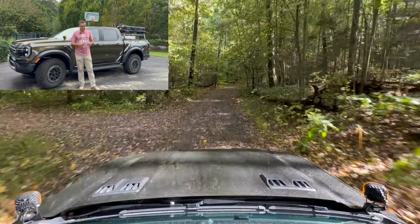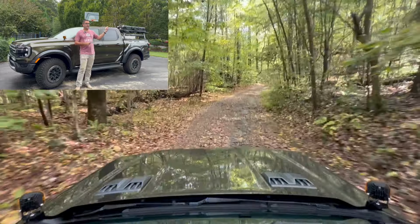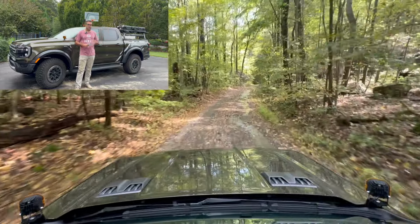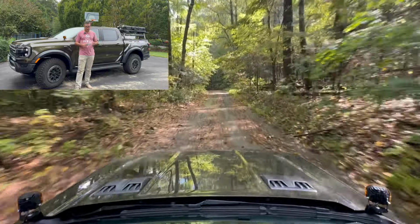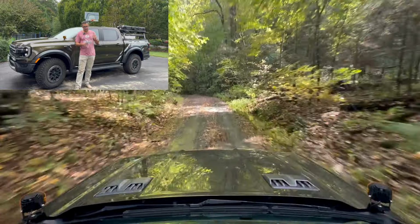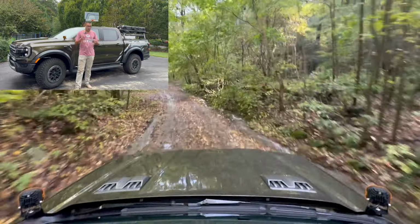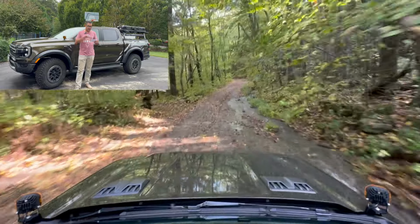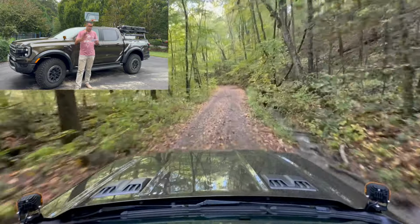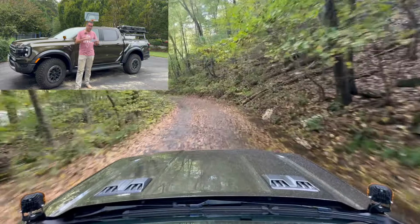So that said, the density altitude for all of the 0 to 60 runs I did back in April, May were in the negative. Because it was so cold and so dense, rich air, it was a density altitude of negative 1600, negative 400, and one of almost 200. That said, they were all within 2 degrees up or down, and I'll go through that. So it was 5.8 0 to 60 at 1 degree up, 5.9 at even, 6.0 at 2 up, 5.8 at 1 up, 5.6 at negative 2, 5.7 at 0.5.